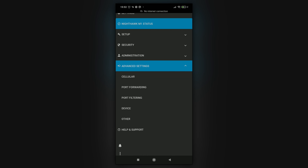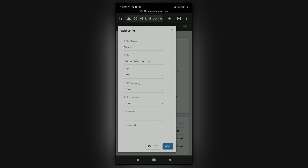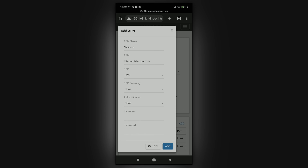Now go to Advanced Settings, then Cellular. Here you want to enable data and set band region to auto. For network mode, you can leave it on automatic, but sometimes the Nighthawk stubbornly tries to connect through Verizon even with an AT&T SIM card — if that happens, switch to manual and select your provider manually. You can also Google the APN settings for your provider and enter them here — this is essentially your login info into their network using your SIM card.